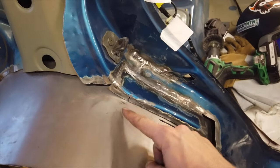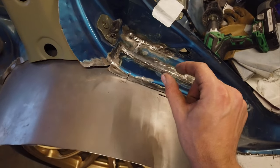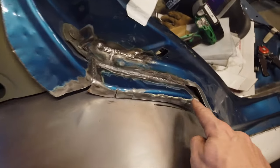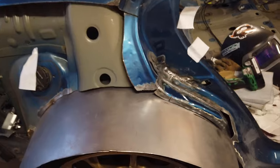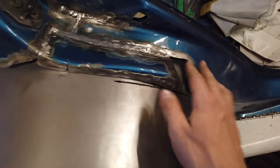I've just finished modifying the door jamb. What I did is cut this entire piece out and placed it two centimeters higher, away from the tires. That gives me just enough room for my wheel arch to go there and also for the rubber seal to go against this part of the metal and seal, so that everything remains watertight just like it is from factory. That's all good to go now.